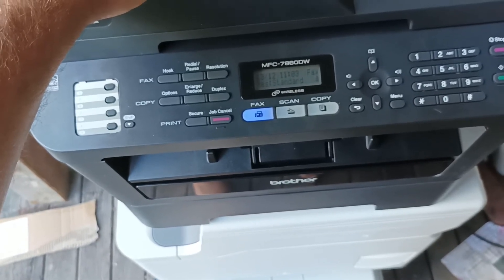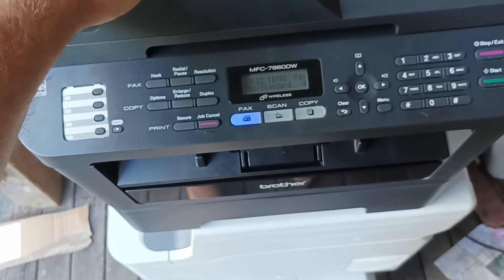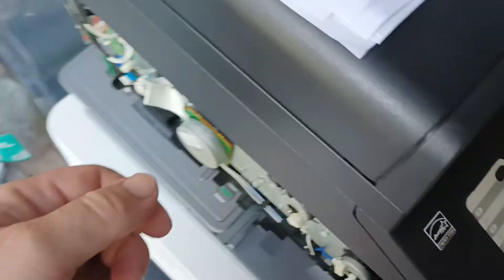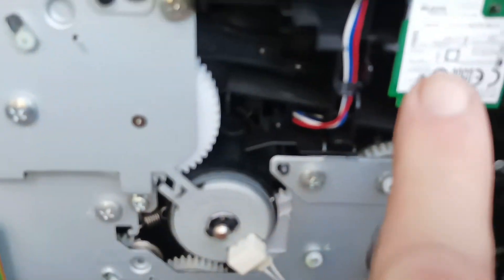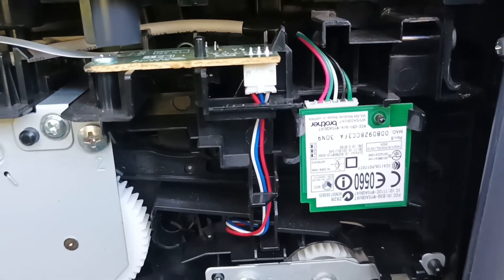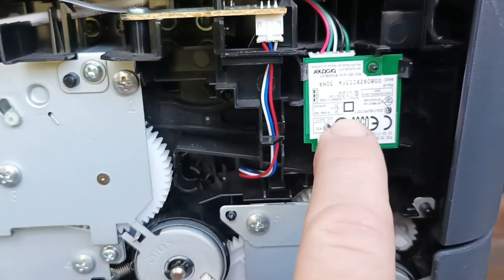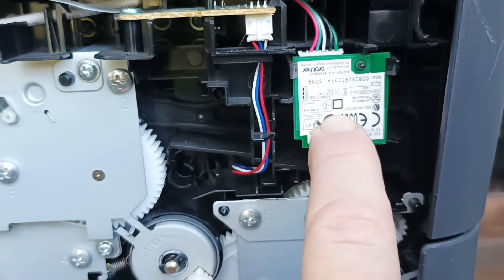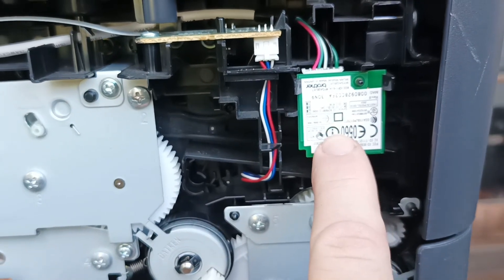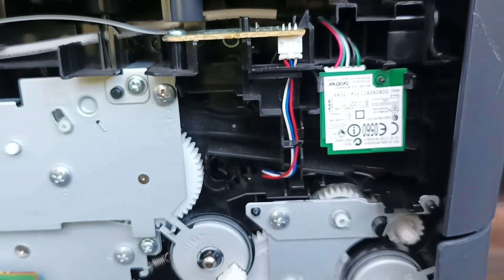There's no other way of making it work other than going out and buying a brand new Brother printer. If I could change this wireless card for a new modern wireless card, that would also get around this issue. It just seems to be older modems that connect at 802.11b, because these older cards can't do 11n and they don't support 11g Wi-Fi connections.